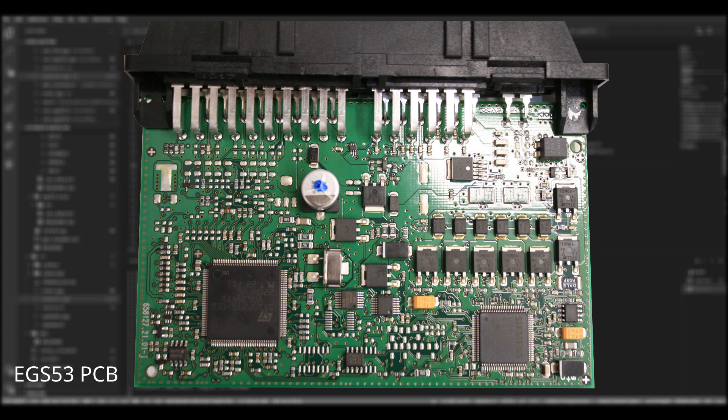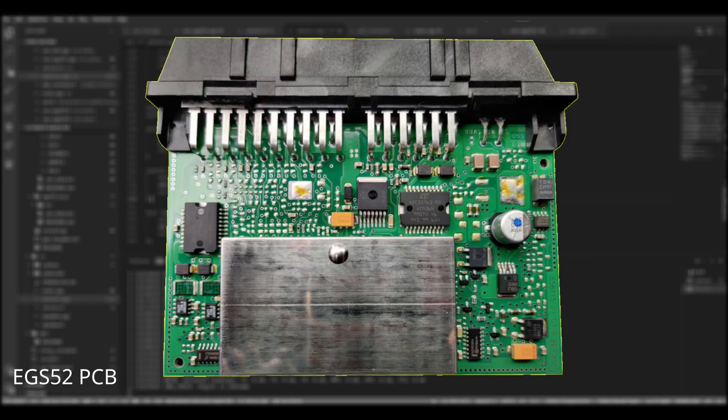This part number is a lie. Even though the module in the vehicle was marked as EGS-53, and the physical PCB is indeed that of an EGS-53 module compared to EGS-52, the software running on this EGS-53 module is actually designed to be compatible with the older EGS-52 CAN network. It seems the transport sector of Mercedes simply uses hand-me-down parts from their passenger vehicles division. After we realised this and flashed the EGS-52 code on my controller, it did work as expected, but unfortunately there was no light and it was very late in the day, so I didn't film any of that.